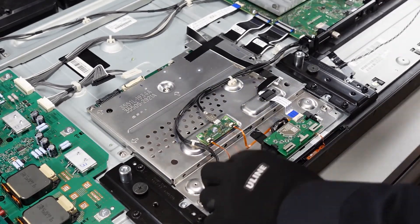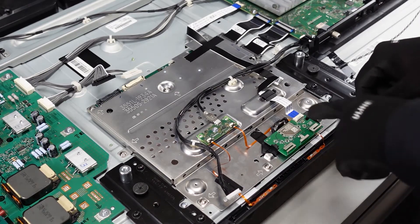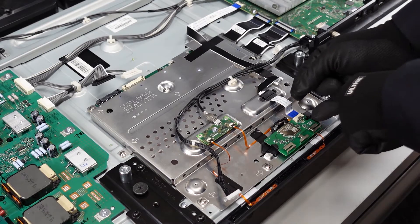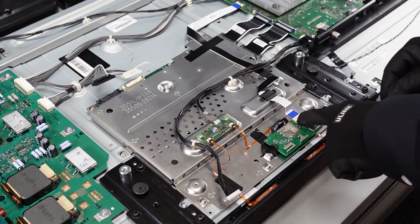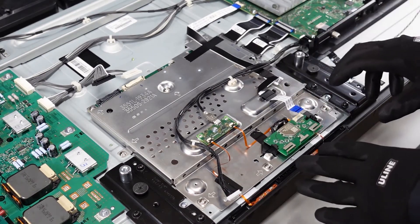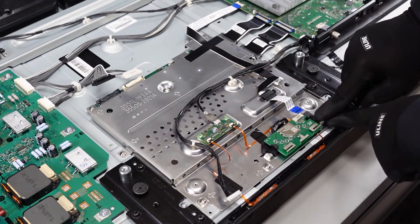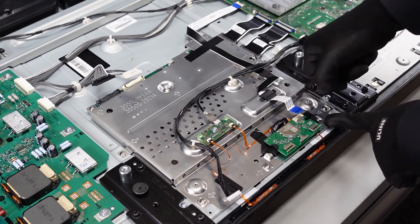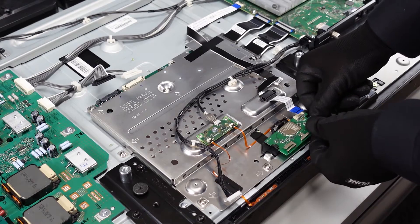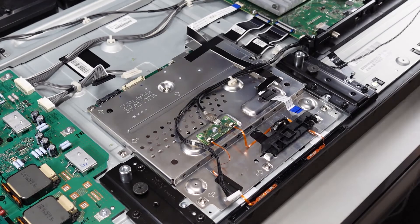Now focus on this Wi-Fi card. This metal latch right here — press straight down on it and pull this ribbon out. Press and the ribbon will come right out just like so. Now let's get this whole piece removed: there's a latch on the side of the Wi-Fi card — pull it away from the board gently and hold it in place — and you should be able to lift this up and slide it out from the other latch. Now we have our Wi-Fi card removed.